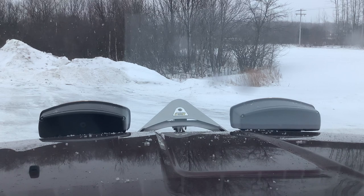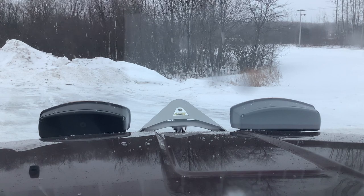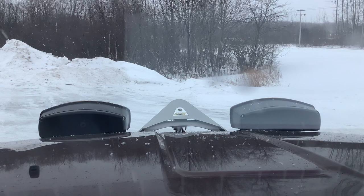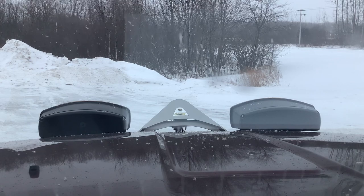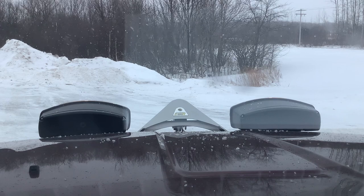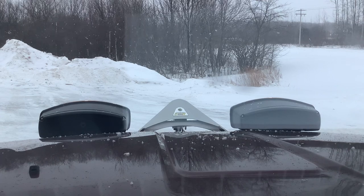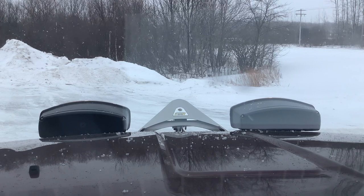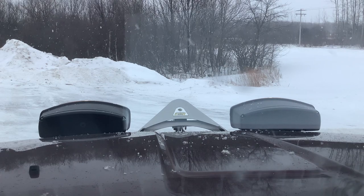I've got a video coming up inside tomorrow. We've got the box off the 49 Ford. We're going to get the bodywork roughed up on it and going to get some primer on it maybe tomorrow afternoon, and then probably Wednesday or Thursday I'll put a couple 2-3 coats of paint on it, and then we can reinstall it and put the flooring in it, and then we'll start working on the interior on that and getting the front bumpers and rear bumpers made for Jordan. And come first part of May, he'll be ready to drive that every day. It'll be his daily driver. That's that 48 Ford sitting on a 83 Ford F-350 chassis, and we swapped out and put a Cummins in it with a 5-speed.